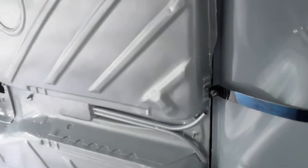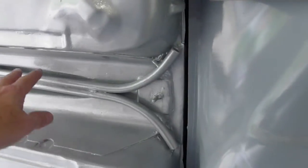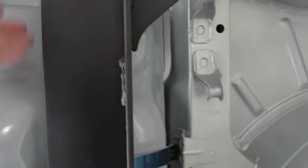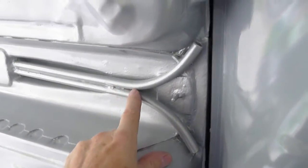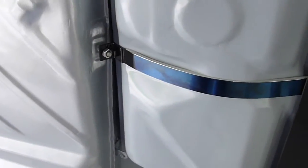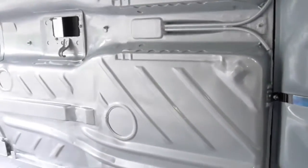So gas on one side and the brake line on the other side. Over here I've got the e-brakes, the emergency brakes. They used to run stock up to these platforms here on each end, which makes a mess of trying to get the exhaust system routed — which goes up through and over the axle and then across the back. So what I did is I built new lines here, and then I'll get the e-brakes run underneath the strap, around, and then over the axle. Basically it's cleaner — it's out of the way, they're not going to be hanging down looking like they did stock.